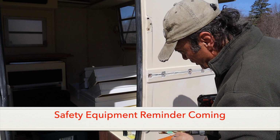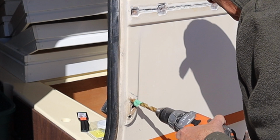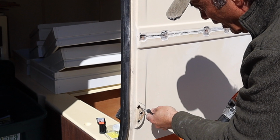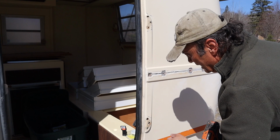So that looks like I got rid of a lot of the rotted wood in there. I'll clean up this edge here and sand that a bit later. I know it looks like it's really soft and rotted, but when I poke into the side here, it is still pretty hard. And I think when I put in the epoxy and the dowel, it'll do the trick. Later on, if I want to, I may end up approaching from the back and replacing that whole piece of wood. But in order to get on with the project, I need to secure this for now.